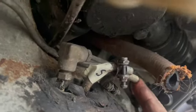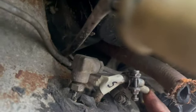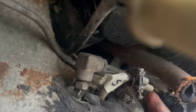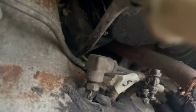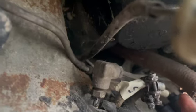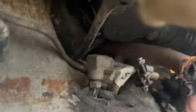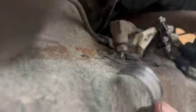Okay, up under the car here, working in the fuel pump area. So what we did was just blew the lines out. And one is return, we're going to call this one supply right now by looking at the diagram. I think I'm accurate, but we blew both lines out, cleaned them, cleared them, and then we correlated and made sure it was the same thing on the back end, back by the fuel console. One of them is supply, one of them is return. That's air conditioning. If we do get the air working back on this car, we're going to replace all of the lines. I'm going to leave the factory brackets.